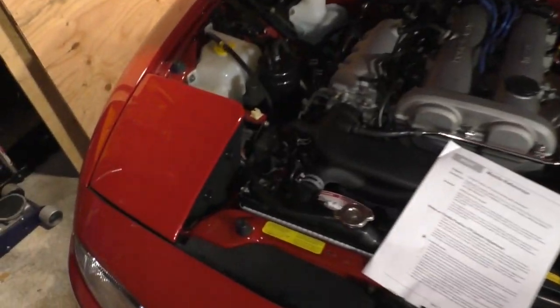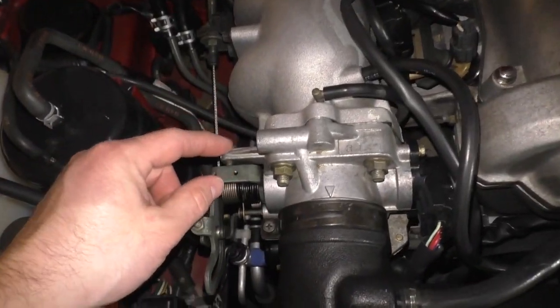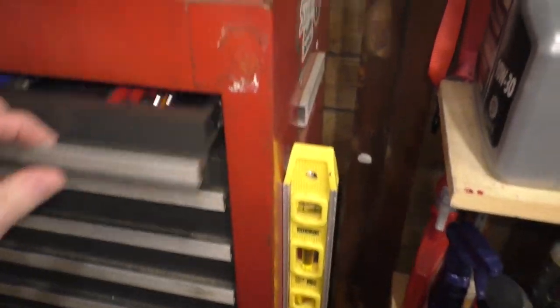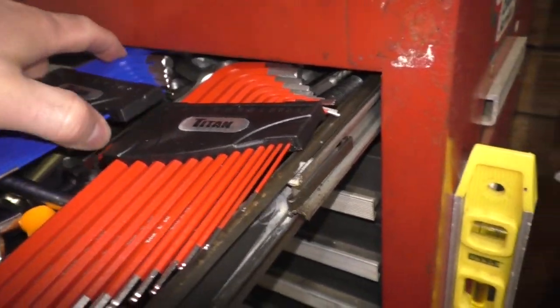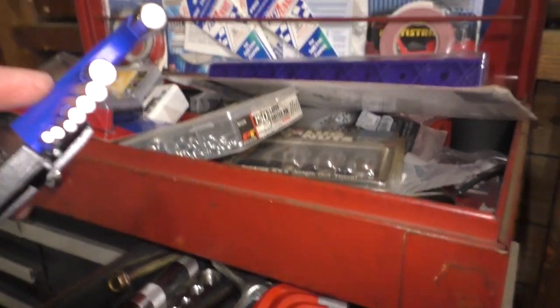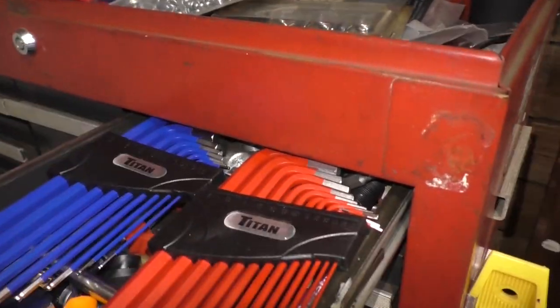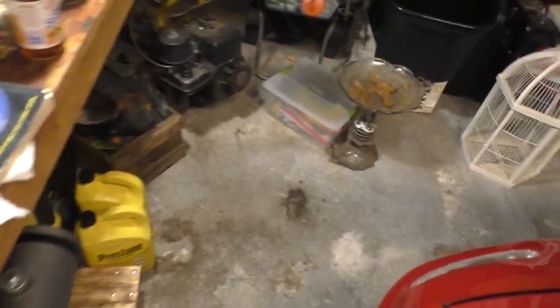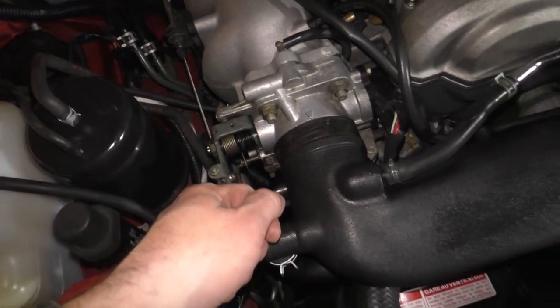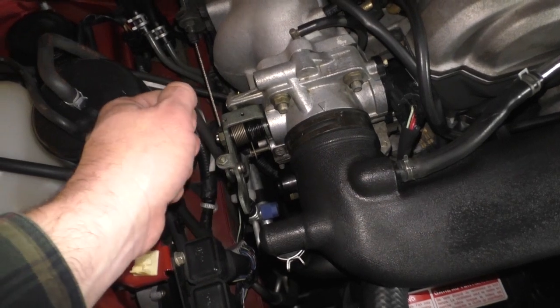you're going to loosen up this lock nut here, and you're going to get yourself a, let's see, what size Allen key did we use? I think I would have this stuff all ready for you, right? You're going to use, I believe it was a 2.5 millimeter Allen key. It's metric, so get a metric Allen key set. Should have what you need. And you're going to, very ever so slightly, adjust the position of the stop screw while manipulating that feeler gauge. Just get it just so.